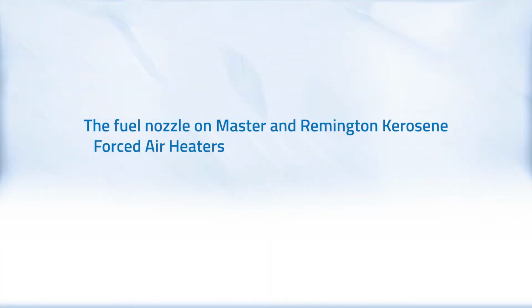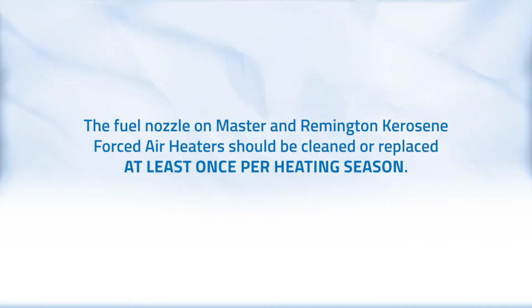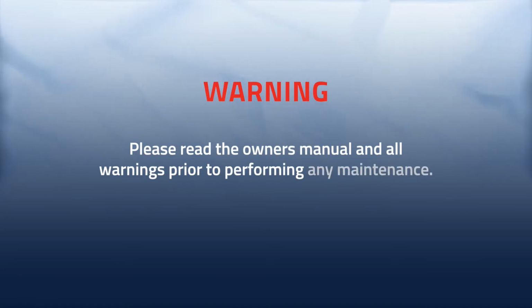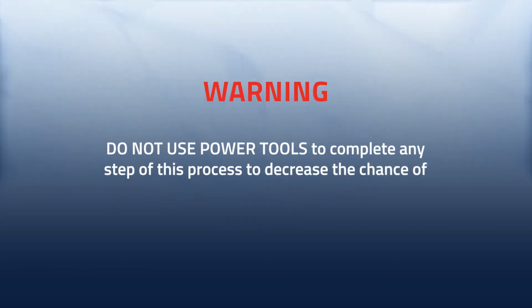The fuel nozzle on Master and Remington Kerosene forced air heaters should be cleaned or replaced at least once per heating season. Contaminated fuel could make this necessary immediately. Please read the owner's manual and all warnings prior to performing any maintenance on your heater. Do not use power tools to complete any step of this process to decrease the chance of damaging your heater.